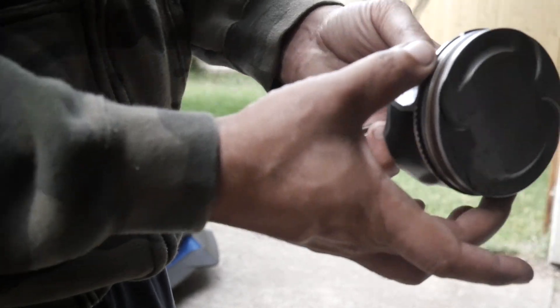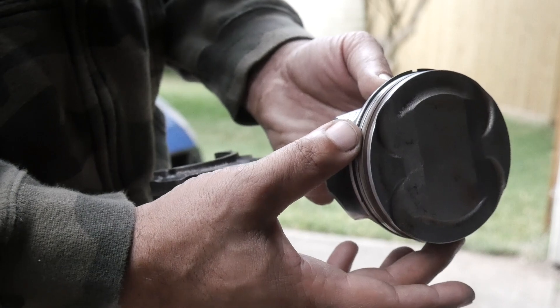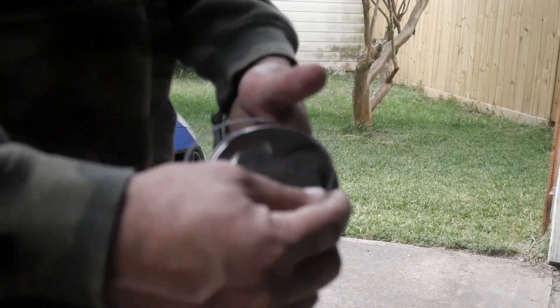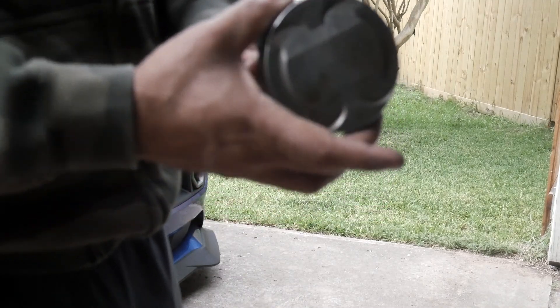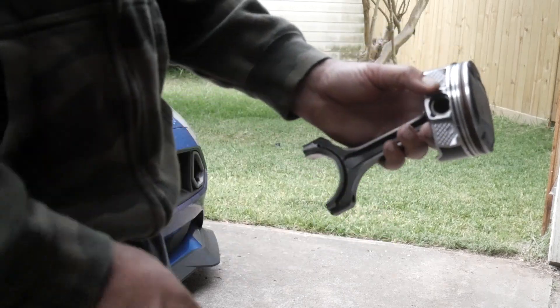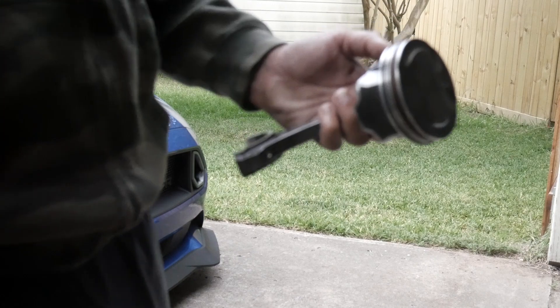So we're going to start over here, make sure it's nestled in there where it needs to be. Just kind of work it around, bring it slowly down and make sure it doesn't get stuck on top of that ridge. Move around — nice. You got a little bit of play but not too much. And then I have our other oil ring scraper here, so I like to flip it a full 180 degrees around from where I put the other one. Make sure it gets down in there below where it needs to be. Start bringing it around — there we go, the other one's in, still moving around the way it needs to. Everything's in there looking good, everything is lined up where I want it to be.